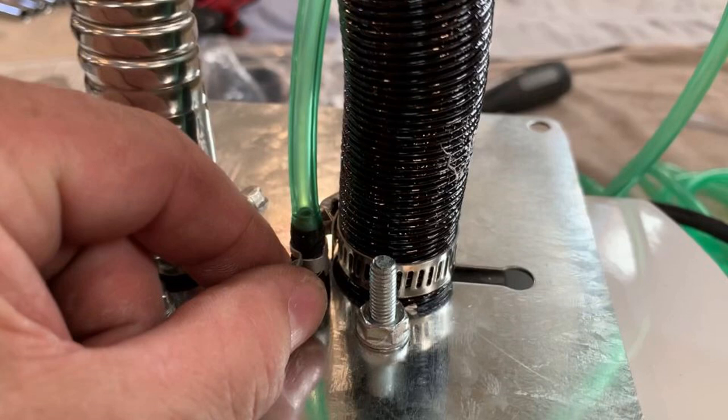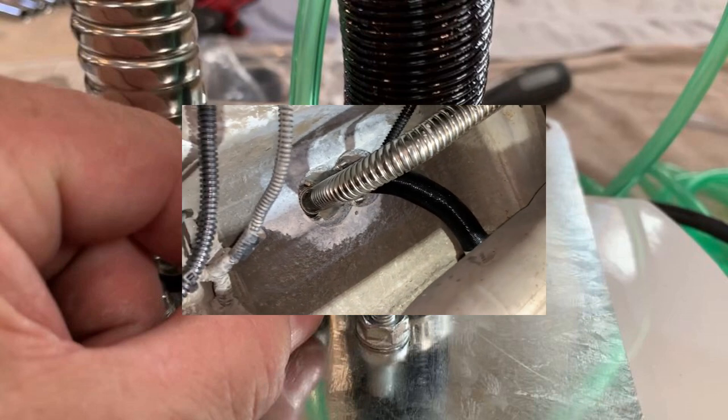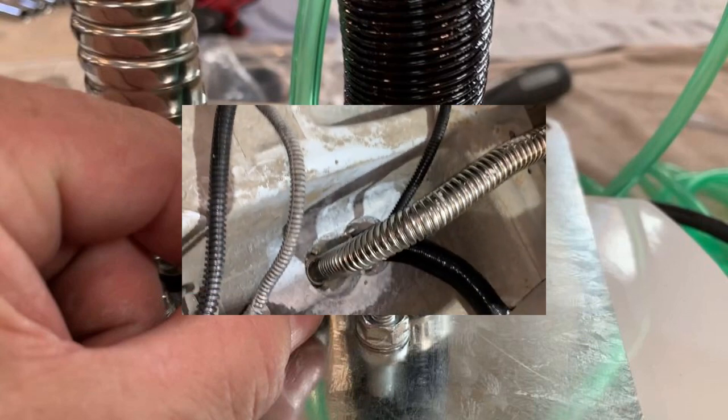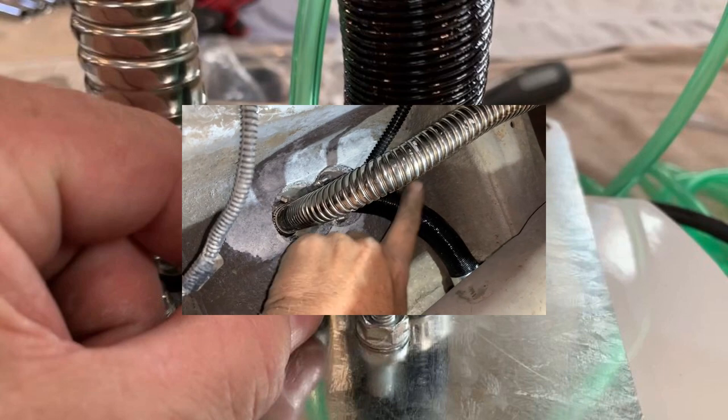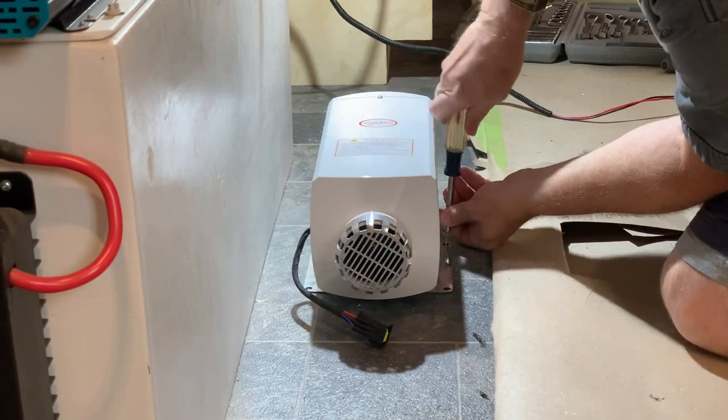Okay, this is a really good time to stop the video. As pleased as I am with my progress, here is mistake number one. You see this slot in the cover plate? The manual doesn't talk about it, and only after I installed this unit does it occur to me that it has a purpose. Your electrical wire that feeds the fuel pump needs to be placed here. It is slotted so you can fit the electrical plug end through the larger hole and then slide the wire into the slot. This isn't documented anywhere, and by the time I discovered this, the heater was installed, the muffler was mounted, the air intake was mounted, and a good portion of the fuel line was mounted — all of which would have to be removed to make use of this hole and slot.